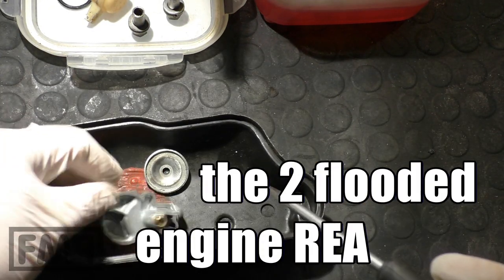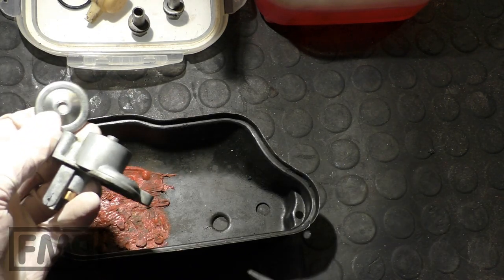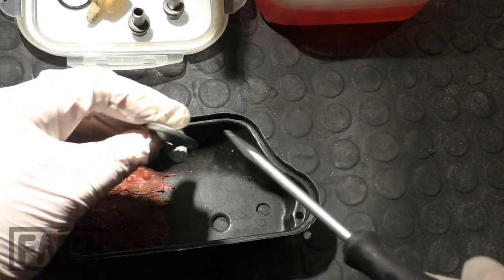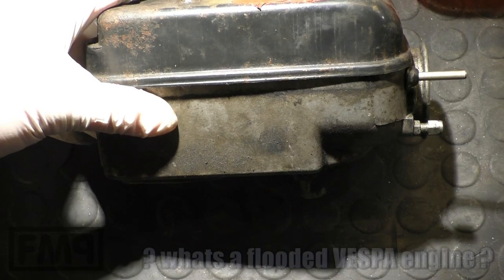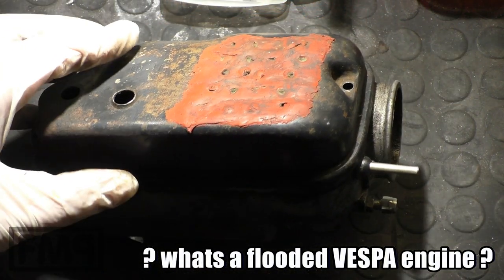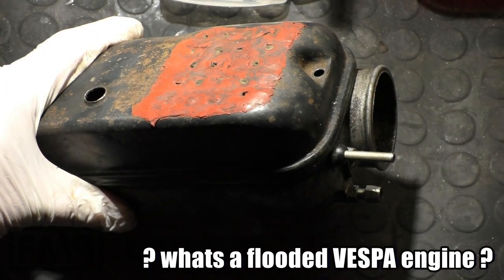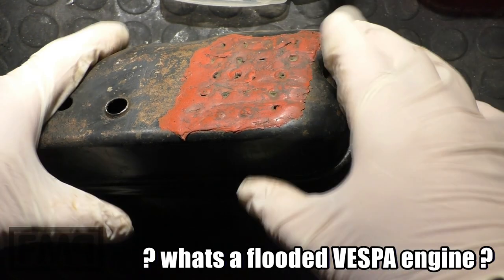Here is hidden the worst bungling of Piaggio ever. It's so bad. It annoys hundreds of thousands of people worldwide, I bet. Carburetor casing, a speciality of Vespa engines. The carburetor sits in a closed case. Usually there are rubbers everywhere and it's a closed room, connected to the frame where the fresh air comes in from that hole under the seat.